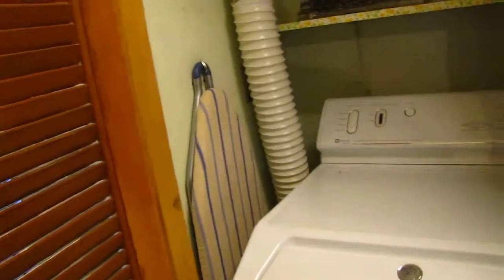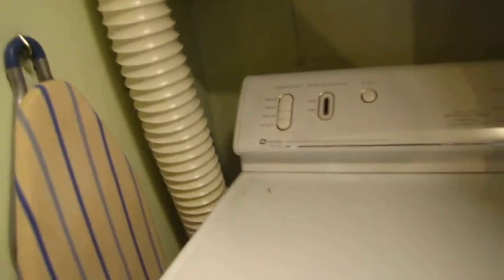Our customer has a diagnosis on a dryer that's failing because of a heat sensor, and this vent is coming down. It's got reasonable 90-degree turns and such that I don't see a pinch, and the problem is, you can tell, it's going up into the wall there.